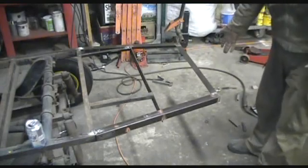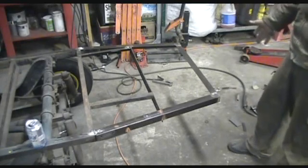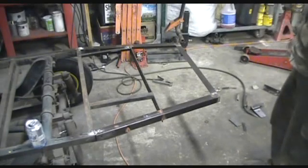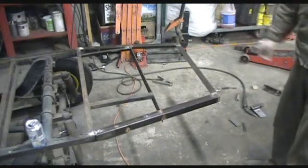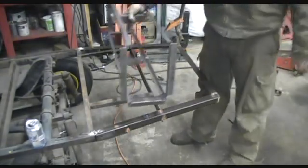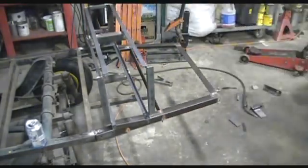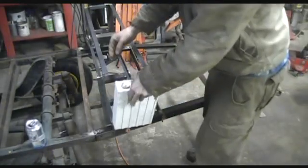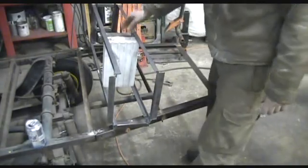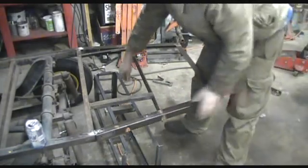I was thinking about going a little further, but it's just not practical with the overall length of the vehicle. I wanted to keep the whole vehicle length under 12 feet, and right now it's a little over 11. So this is fine for now — I may choose to go a little further later on, but for now this is perfect. I've got the first battery tray mocked up. This brace in the middle is just a temporary brace. You can see the cells just squeak in here like that, and obviously they'll go full length once they're in. These batteries have to be under compression, which is why I built the frame this way.